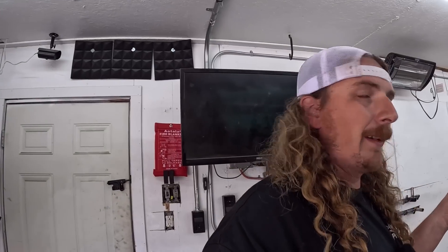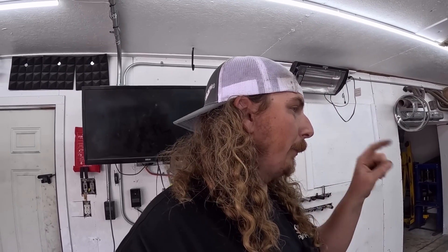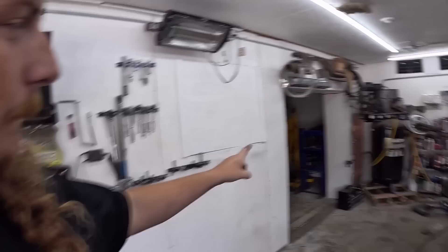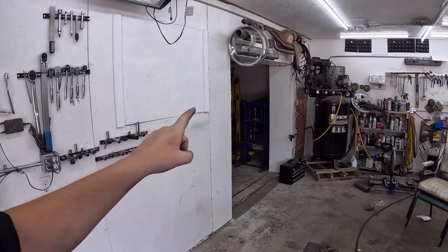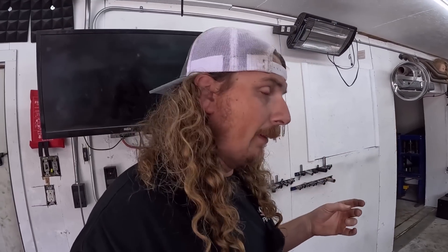I was under it and I was like, I don't really want to paint it — it kind of looks fine. What I'm going to do is pull the rear wheels, pull the front wheels, clean up the rotors because they've got rust on them — give them a quick buff. The rear we're going to pull off. I'm going to pull out the one spring that's bent and try to straighten it on the press, because that seems like a smart idea and see what happens. Because man, I tried looking them up — they have gotten expensive. So we've got to wait until we find a deal or something. But for now it's fine, it'll be together — it has to come apart anyway to put that bushing in. So we'll just do that and then call it for a day.